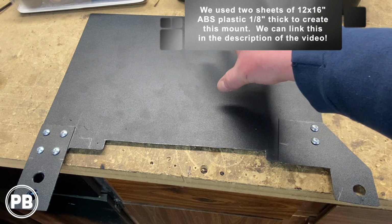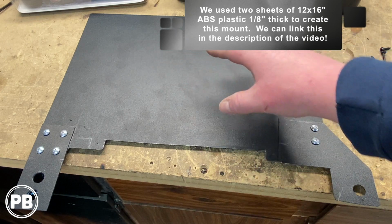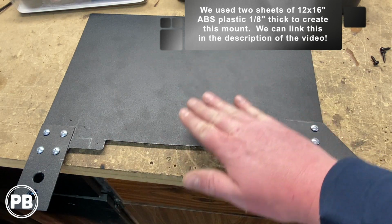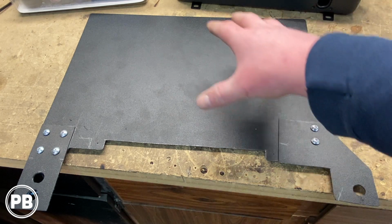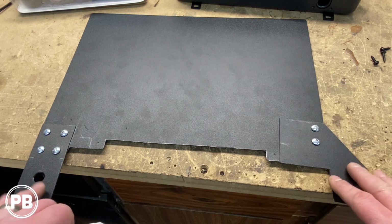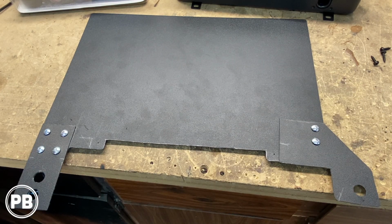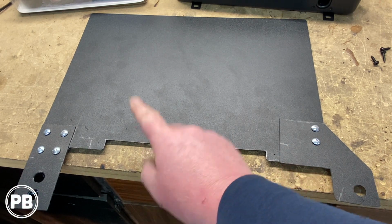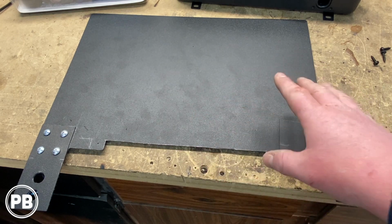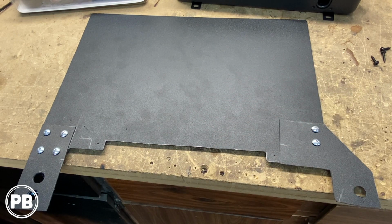There is a vent up in the center of the floor there, and we cut the slit here so it can still vent out. So we're not totally enclosing that floor vent underneath the seat. This will screw to this, and then this will bolt into the factory location up underneath the seat. Again, we're snagging both pegs here and the back seat bolt. We've already pre-drilled. Everything will mount to this plastic sheet. This was a 12 by 16 ABS sheet, and we can link one of these in the description in case you want to pick some up yourself.